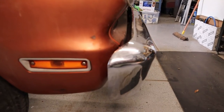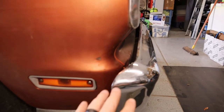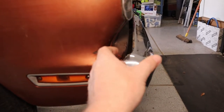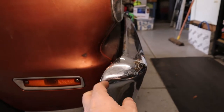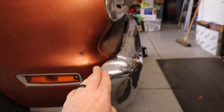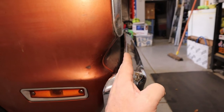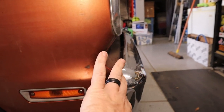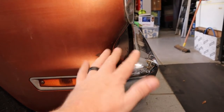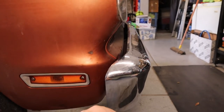I've been looking at the front bumper of the D100 and I think it should be a relatively simple thing to pull the bumper, take a look at the bracketry, and either move the bracket back or take a piece out of the bracket in order to pull this bumper back probably about an inch, inch and a half. You can see just how much it protrudes past the front of the grill, so I think I want to try to tuck it up — maybe an inch, maybe an inch and a quarter. Let's grab a tape measure and see what kind of room I have.